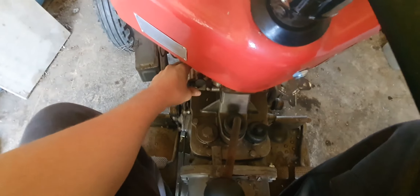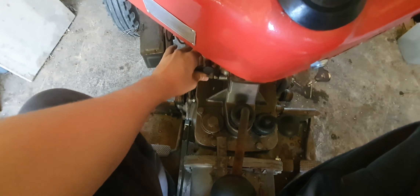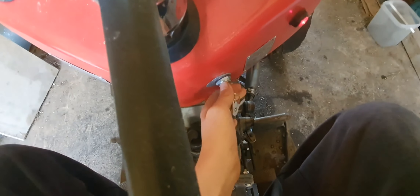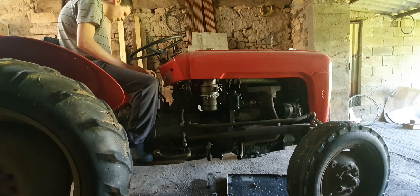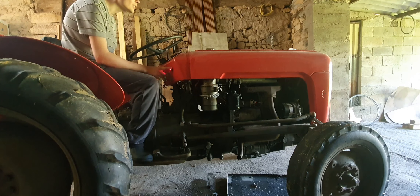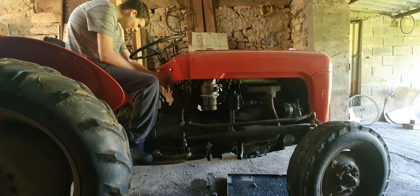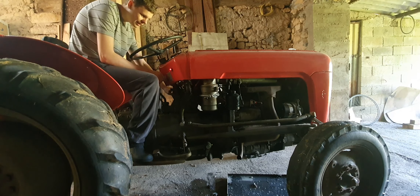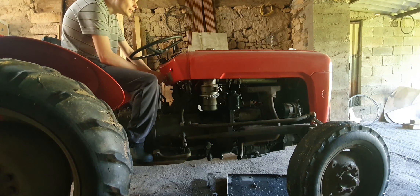At the same time we've got to press the plunger pump until it builds up pressure, so now it's becoming firm — we're pumping fuel into the intake. We have to glow for a while. Make sure this is in neutral and that's in neutral because there are switches; you can also press the clutch. Okay, you've got power, the alternator light is on. You should glow and pump at the same time. You can feel the pressure building. And now you just glow your tractor.